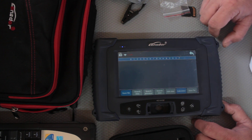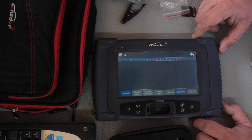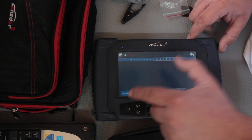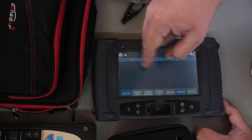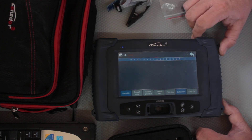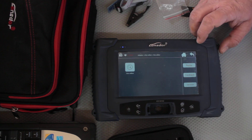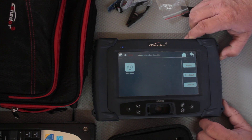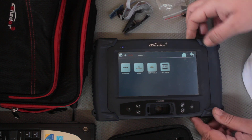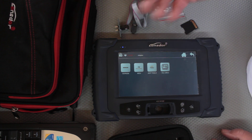I think it's a bit of a hit and miss. I was also upset that it doesn't have a key-making function where you could put the chip in, push a button, and it would enter the data into the necessary spots so you could press write and it would write down to the chip. None of that exists on this machine at the moment. So as far as key making in that particular method, the Tango, ZedFull, and the other machines still have the monopoly. A simple hundred dollar eProm programmer lets me take my virgin files and write them down — I can't do that on this.